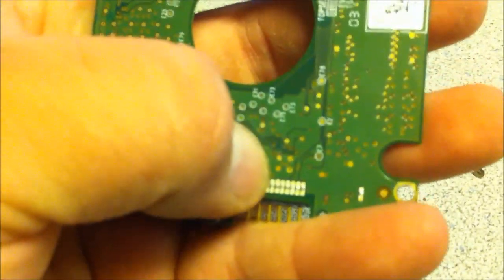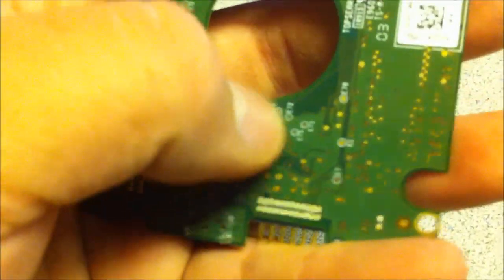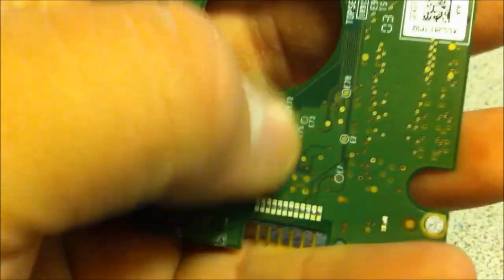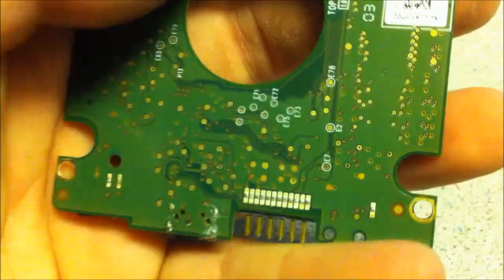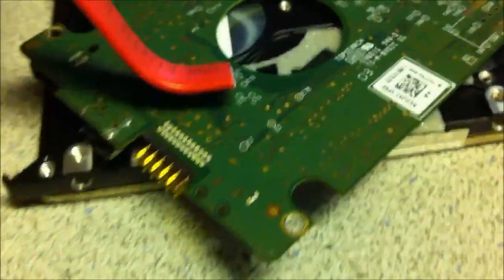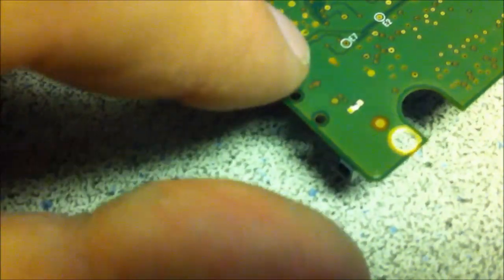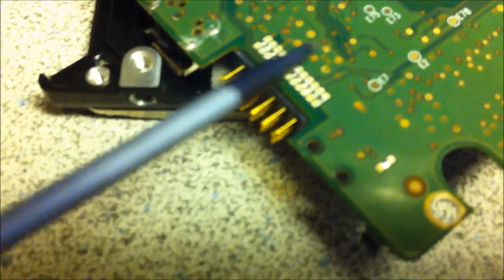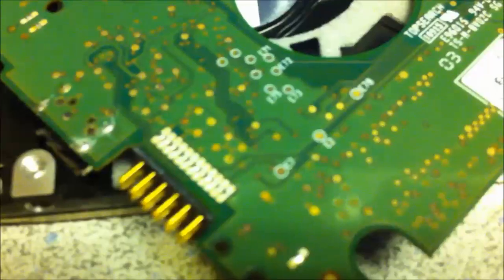What I'm going to be doing is hooking up my two powers here and my SATA connection directly to the board. Those are your SATA connection and your two powers. I'm going to be hooking up just a standard SATA cable to it - I'm going to be soldering that sucker right on there. Of course I'm going to be separating all the wires, and for the power it's just these two first pins on there - the first set right here and the first set right there.